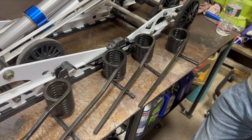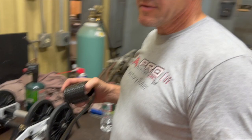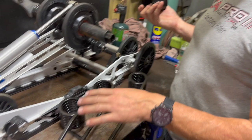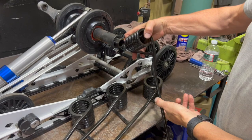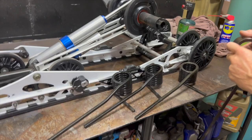We're really here to talk about springs today. So the sled comes stock with a 359 — most spring poundages go by wire diameters, and in this case they're square. You go from 359 to 375. These are measured at 11 pounds per degree — how many pounds it takes to bend the spring. When these are loaded on and snapped in, the springs are moving a lot, so resilience is important. That's why sometimes after a while you have to click up to medium or high because they get sacked out a little bit.